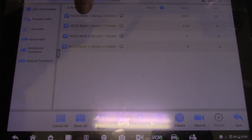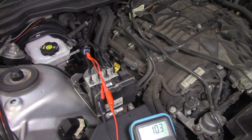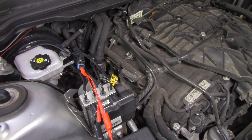The diagnostic techniques I'd like to share with you are very basic. They're nothing exciting and anyone who has a few basic tools should be able to do it. So there's bank 1, heater 1 and heater 2 — they're clearly drawing some current. And over here bank 2, heater 1 and heater 2 — no current being drawn whatsoever. For the sake of the exercise I'm on bank 1 just to show you guys what a good oxygen sensor and circuit should look like.